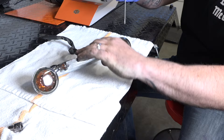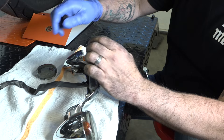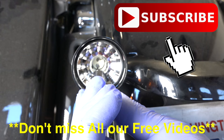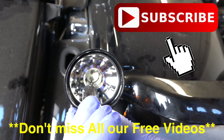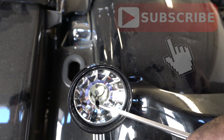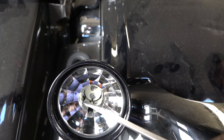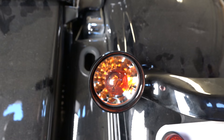Now we're taking the old tail lights — we've got to reuse the bulbs and the lens cap. There's a little gap on these that you can stick a screwdriver into, and they'll pop off. The bulbs push in and quarter-turn to come out. Use a glove so you don't get oils and greases on the bulbs. Now for bulb installation — you'll see nipples on the side of these bulbs. One would think that big groove is where the nipple lines up, but it's not the case; you'll actually break them. There's a channel off to the side — that's what you're shooting for. Line the nipple up with that channel, push in, quarter turn. Done.